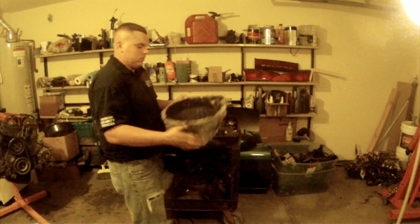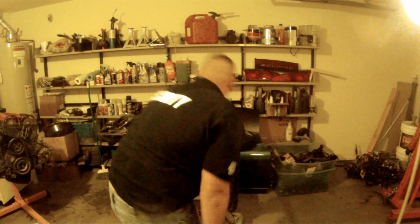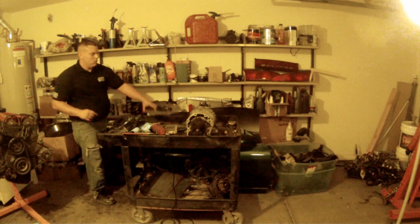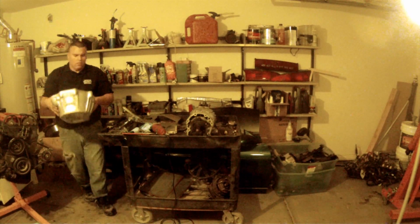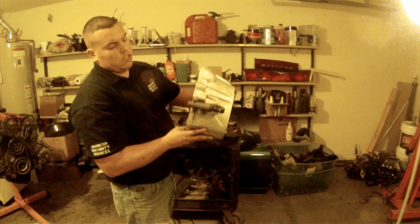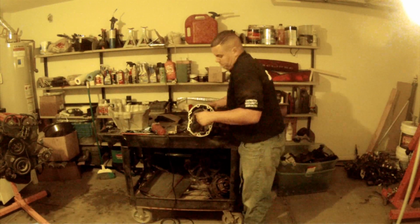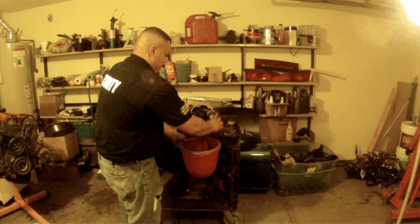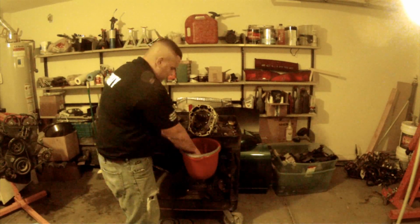So this is the stock W58 bell housing for that 7M, the crappy super engine, the non-turbo. This is the bell housing from Bill. It's got a Supra slave cylinder, and it uses a Mitsubishi clutch fork, Mitsubishi pivot ball, and then I'm using the Toyota Supra throwout bearing.